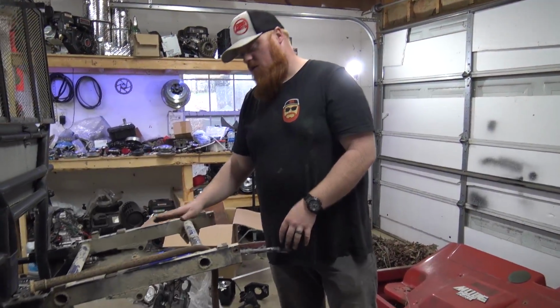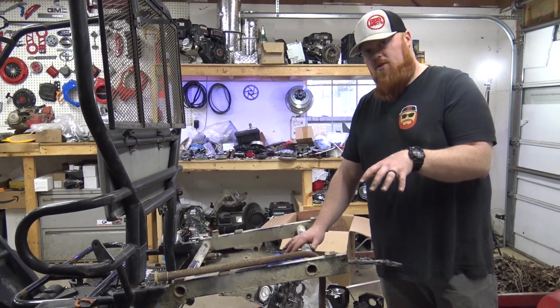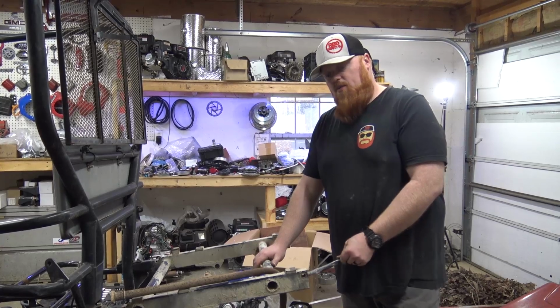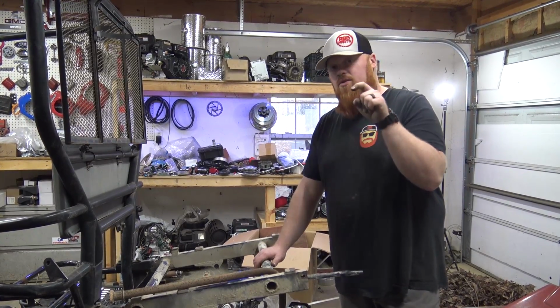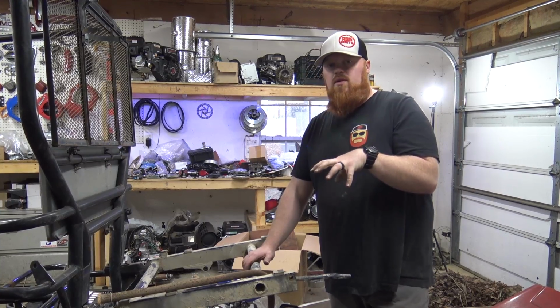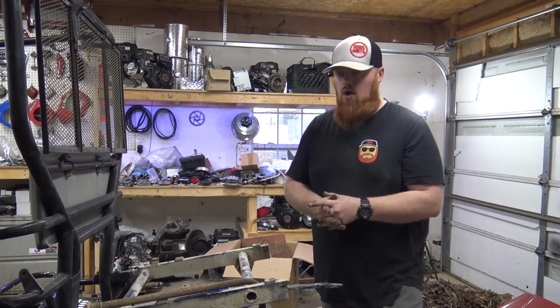We're going to slide this on now. We're probably going to have to pull that torque converter pulley back off because Go Power Sports is sending us a custom belt. Not a custom, but a belt that should work out better, and we can use that Comet pulley. We end up having to use the original pulley on it, but we want to use a Comet pulley that we have adjusted for 2,000 RPM stall.